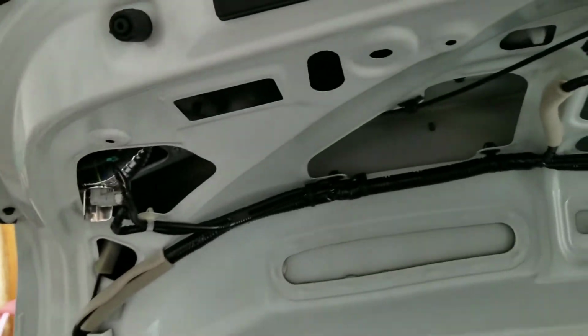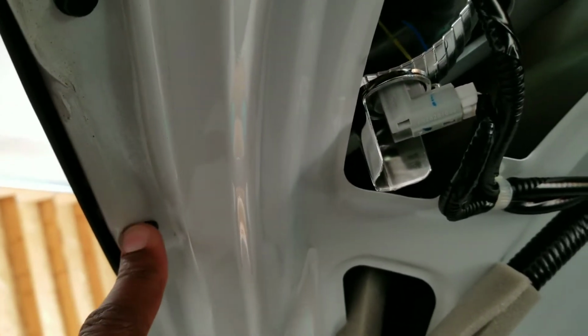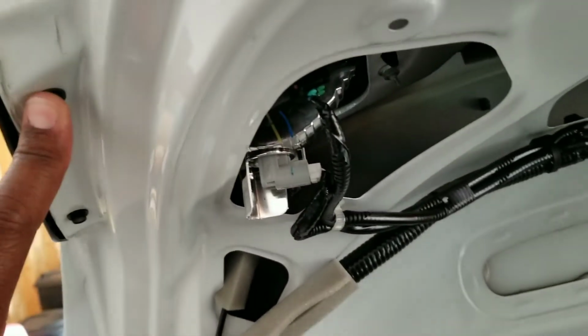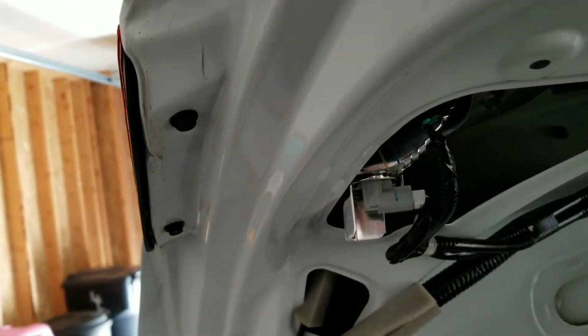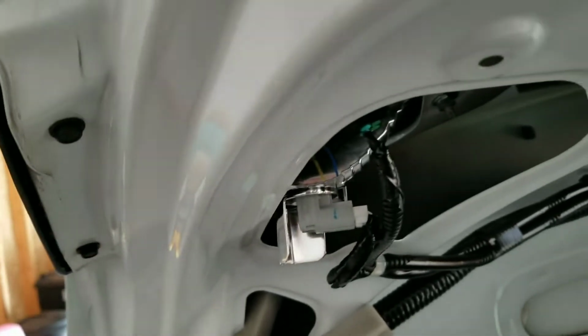One thing to note though, to remove your tail light, there are bolts right here, start there, and then there are spots with bolts inside. There's one here, also the two on this side as well. Oh, and those bolts are 8mm. If you don't have 8mm, the cross reference for that, I believe, is 5/16. Both will take these off.